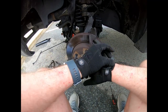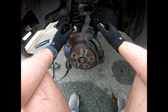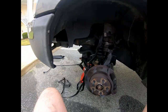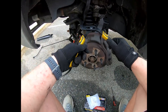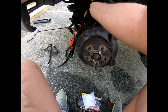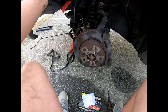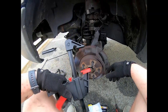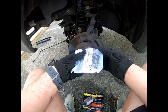I'm going to get a clamp out here just in case this piston is not pushed in far enough whenever I go to put it back on. This is the kind of clamp I got - channel locks probably work just fine too. You can open them wide. If you need to use a clamp you can open this really wide until it pushes down far enough. We'll address that if we need to when the time comes.